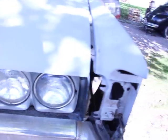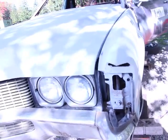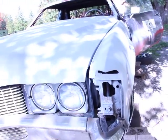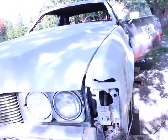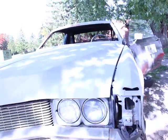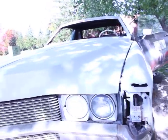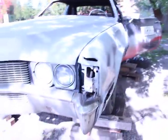There's a piece of trim around here. Used to go under there, and I just had to use a plasma torch to melt them off. And one thing I'd like to mention is that when you're using the plasma cutter to remove a bolt, you usually want to keep the original hole undamaged. To do that, you have to aim the plasma cutter right in the center of the bolt. But be very careful, because by doing so, the sparks fly back at you. So just be very careful.